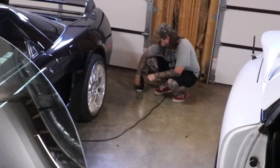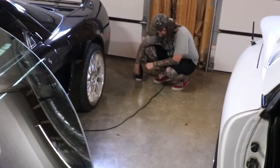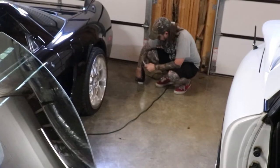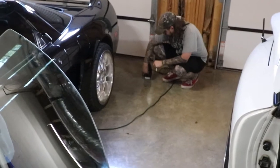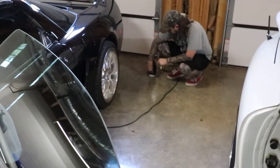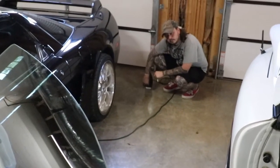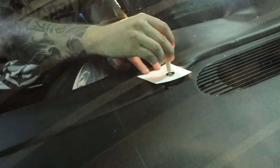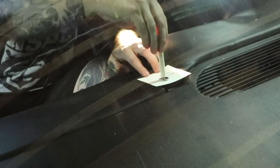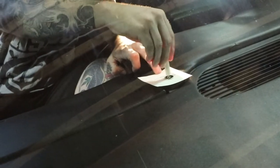So right now Coley is actually putting the heat transfer device against an iron to heat it up, and then he's got the transfer paper which will go onto the wet paint. It'll heat it up, it stays there until it cools, and then we remove it. Roughly you're trying to get this little heat tool to 300 degrees Fahrenheit. And it does say in the instructions to roll it as he is doing.